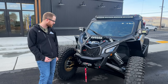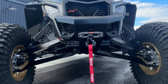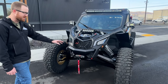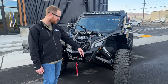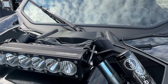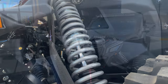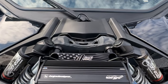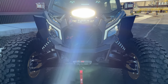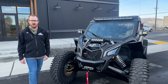Suspension-wise, this car has HCR front and back — this is their dual sport kit. We kept it pretty stealth with the black powder coat. They're holding Keller ball joints. We love Keller ball joints — they're greasable, made in America, best ball joint on the market in our opinion. Suspension-wise we went with MTS Off-Road, with MTS's valving and spring kit. It also has CT Raceworks limit straps, which connect to their shock tower and gusset kit, really strengthening up the front. This package should be very reliable for Danny — it should handle anything he throws at it.